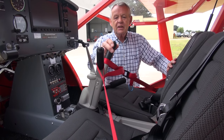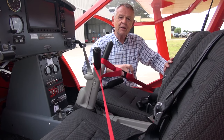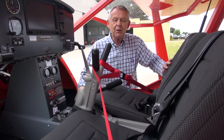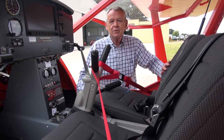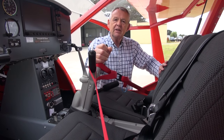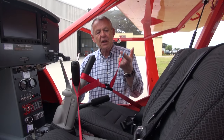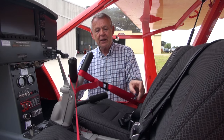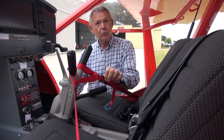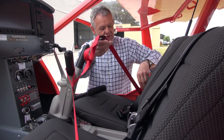Apart from the Y-stick, one of the most obvious things you'll notice straight away is this bright red control lock, which we've specially developed for the Y-shaped handles in the Foxbat and the Vixen. It's very simple — the controls are well locked, there's another strap in between. The strap is tightened by pulling on the adjuster strap and loosened by simply squeezing the adjuster buckle, pulling away and lifting off the top of the stick.